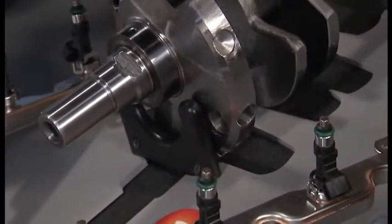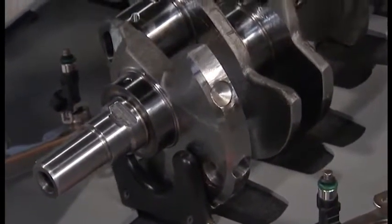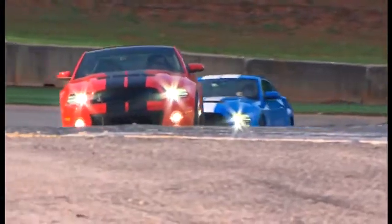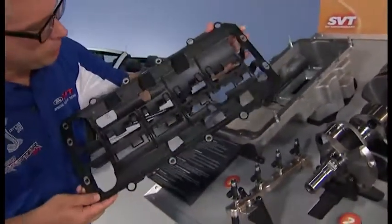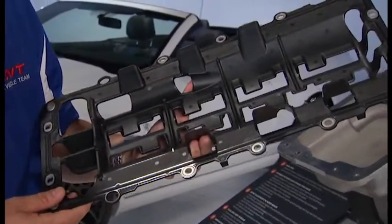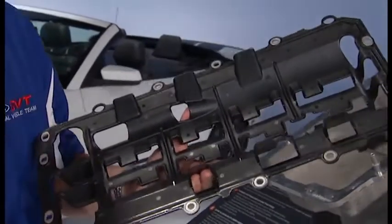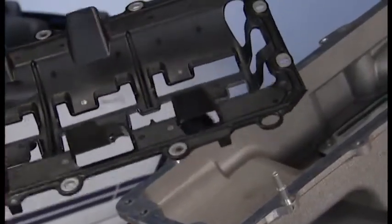That tungsten insert gives us a little extra mass so that when we go through the balancing operation we can achieve the critical balance that is required. Achieving that critical balance is important for this engine that revs to 7000 rpm and has piston speeds that rival F1 and NASCAR engines. Next I'm going to move over to the oil pan and the windage tray. All of these elements are shaped to fit very closely to the crankshaft so that the gaps are very small. We're able to pick up the oil that's flying around inside the crankcase and draw it away from the crankshaft so that the parasitic losses are reduced. That is a facilitator for both better fuel economy and delivering power.